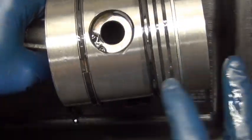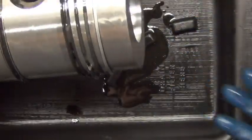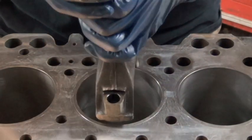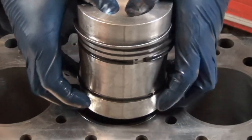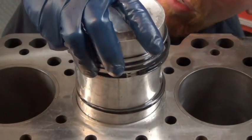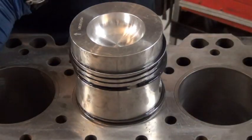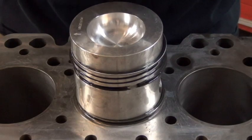Do one more check on all your rings — of course you've got one or two that aren't going to be right because there are five on this one. We're doing cylinder three first. The arrow is pointing to the front of the engine where the timing gear is. Just drop that in there. The connecting rod is pretty wide — just line it up. If you support it, you can get the weight off underneath and it goes in easier. Keep it square and lined up, pointing forward — you'll thank me later when you're hooking up your connecting rods. Don't worry about getting oil all over your piston ring compressor; it's bound to happen.